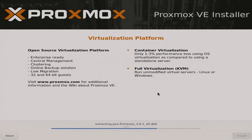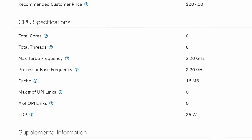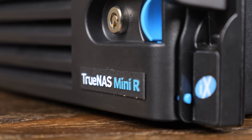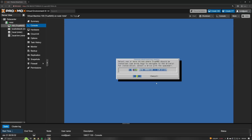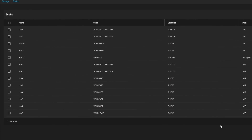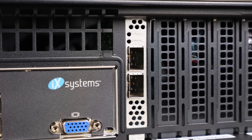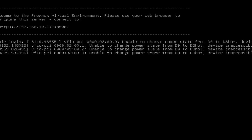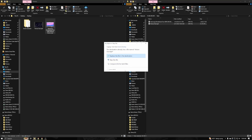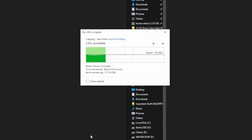In the spirit of tinkering, I decided to give Proxmox a try. While the Atom CPU clocked at 2.2GHz isn't anything crazy, it does have 8 cores and supports virtualization. I figured it would be fitting to set up a VM running TrueNAS Core and pass through the SATA controllers with PCIe passthrough — and that surprisingly worked without any issues. I tried to pass through the SFP Plus card but kept getting a VFIO PCIe error with the message 'unable to change power state,' so I eventually set up a virtual 10GbE NIC instead, which worked fine with just a little overhead. Sequential read and write performance was just a little bit slower than bare metal, and read speeds were actually better than when I had installed TrueNAS Scale.